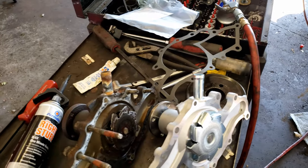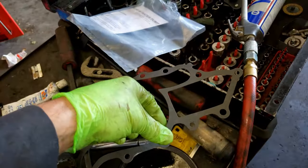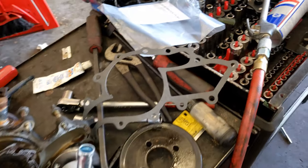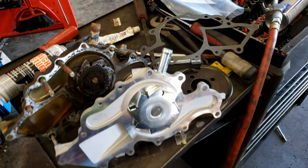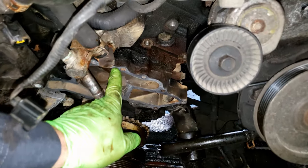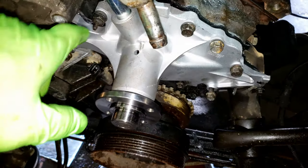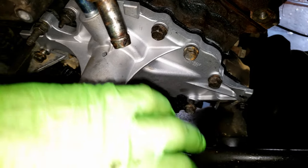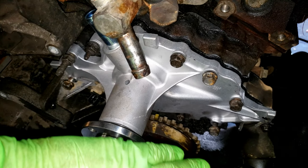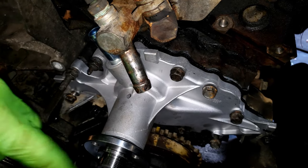Some guys like to put the gasket in dry, which is fine, but I like to take an extra preventative measure. I use Permatex the Right Stuff and rub just the tiniest film layer on the entire gasket on both sides — not a bunch, just a smear around the entire thing. Put that on, bolt it on, and you will never have a leak again. The nice thing is if you did put any gouges in here or it's not a perfectly smooth surface, you're not going to get any leaks. I've got all the bolts hand-threaded in, including the 8mm ones, with RTV or thread sealant on the appropriate bolts.